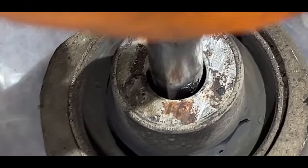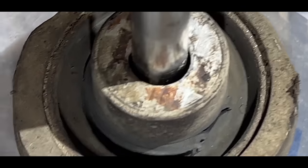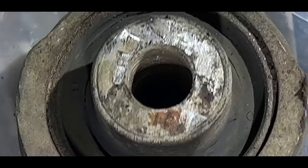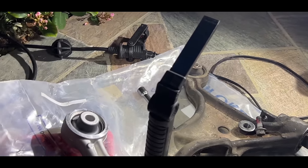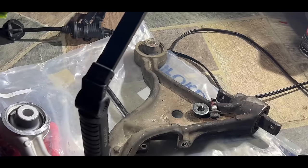The control arm is out, and look how bad these cracks are. This center bushing, with any weight from the control arm, completely ripped out. When the weight of the control arm was holding this down, it was just awful. I'm surprised it's not completely ripped out to the point where I could remove it. It would walk — having a bushing that bad, when you hit a bump the whole wheel just kind of does this. So that's really bad.